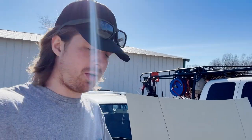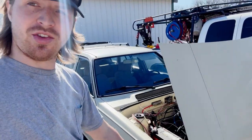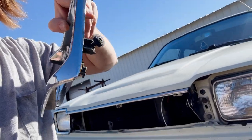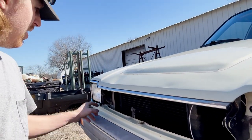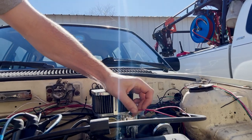I'm going to remove most of the front end parts. I don't really need them while I'm pulling the engine and they're getting in the way — definitely the hood. I'm gonna remove that, the grill, and the headlights. I'll show you something I did on the headlight bezels because mine are broken. Both tabs were broke off on one side so I just ran some screws into the existing tabs and there's a hook right there behind the fender. I also noted a 12-volt ignition source currently going to the choke that I can probably use for something else.